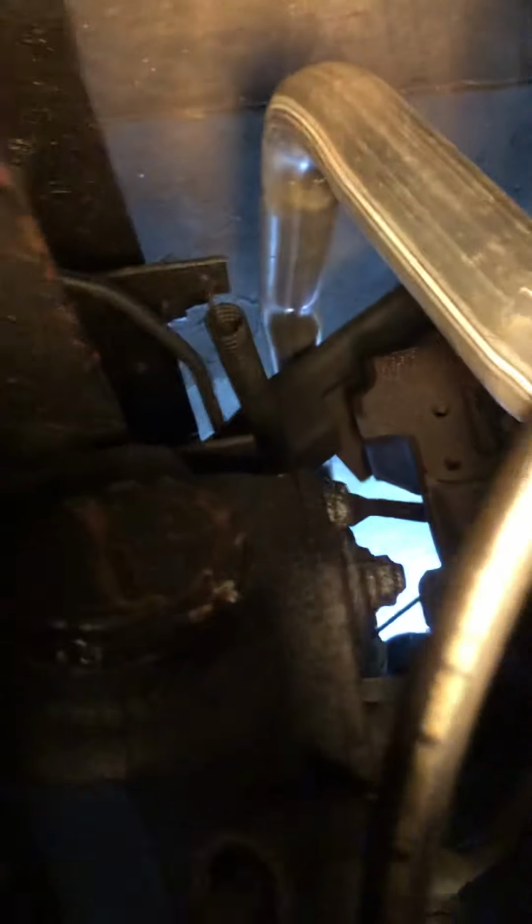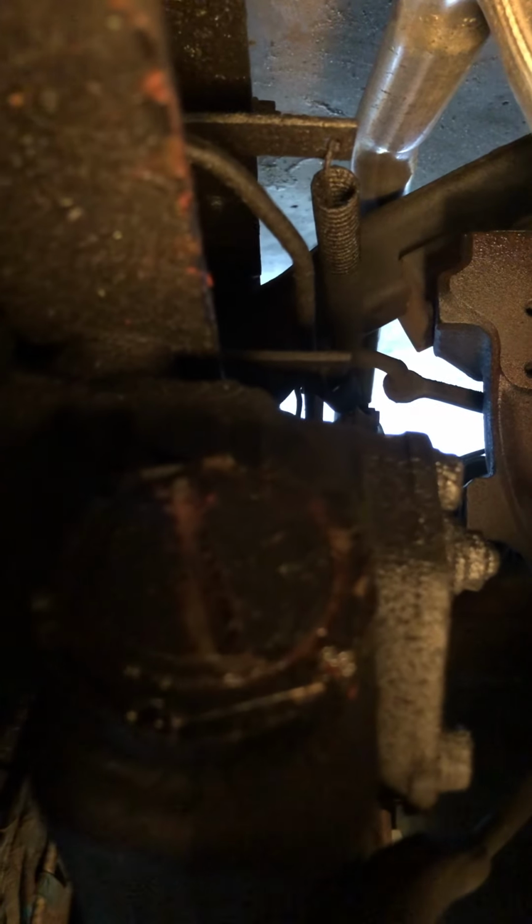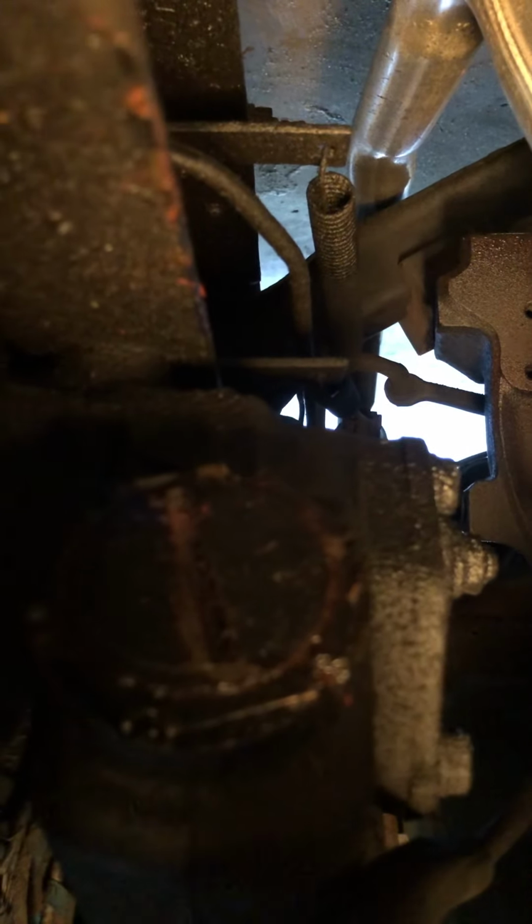See the notches in it? You use a little chisel and a hammer and loosen that. And then in the middle of that nut is a slotted thing. See that? You're not going to find a screwdriver big enough to turn that, so use another chisel or a pry bar or whatever, and make sure the lock nut is good and loose. And then I just tighten that in.